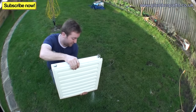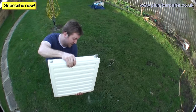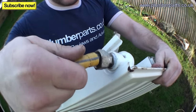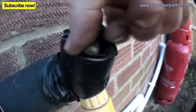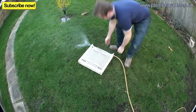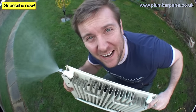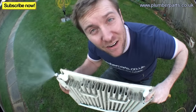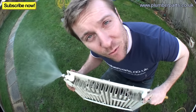Now we're outside — just tip out all the water from the radiator. As you can see, this is a really clean radiator, but there might be a bit of sludge in there, so we'll let all that out. Grab yourself a garden hose and basically try and get it over the end or up against the radiator, then turn the mains water on and blast the radiator through. Sometimes I'll go in from this end, that end, even take the bleeds off at the top, pop a little spigot in there, and try and blast it that way — so you know for sure you've blown out all the sludge.